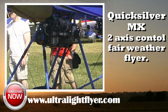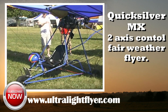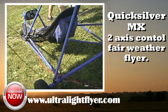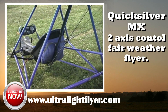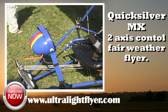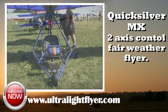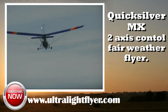The Quicksilver MX is one of the safest, most fun flying ultralight aircraft I have ever flown, and I highly recommend it. The ultralight flyer rates the Quicksilver MX A+, when powered by a Rotax engine, with good fabric, an airworthy propeller, and a low-time engine. Estimated resale value in the year 2020 is $3,500 to $5,000 for a used, not abused MX. If considering purchasing a used Quicksilver MX, it is the ultralight flyer's recommendation that the plane's fabric be tested and the wires, landing gear, and reduction drive be thoroughly inspected. For a troubleshooting report on the MX, visit www.ultralightnews.com.